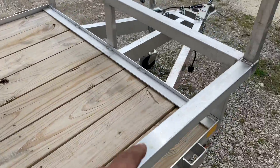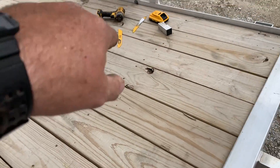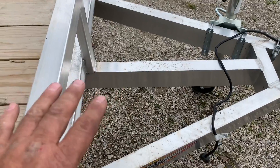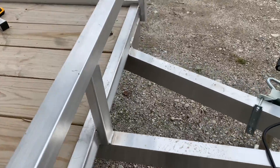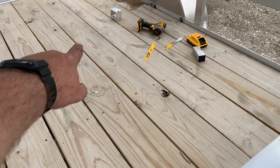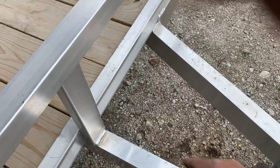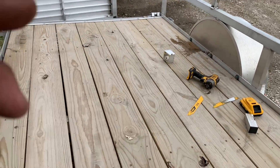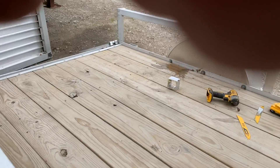That'll give me 4 inches of space down here, and I'm going to take the center section and put my water tank in there. So I'm going to put 4 inches of blow-and-foam in there, then the plywood on top of it, and the water tank on top of that. I may notch out 2 inches in the cross sections back here so I get 2 more inches, and I'll put a piece of 1.5-by-1.5 in the center and weld it in to secure and tighten it up.